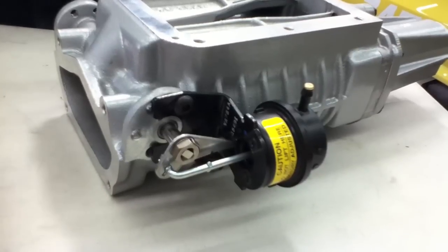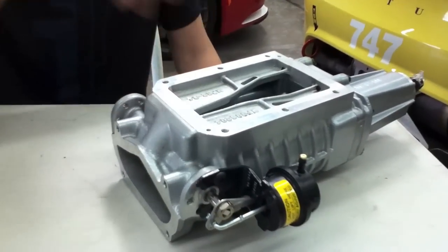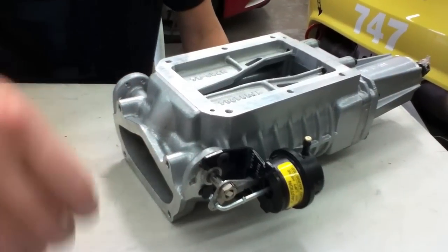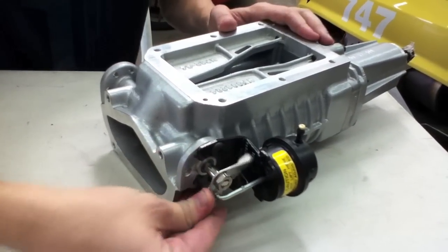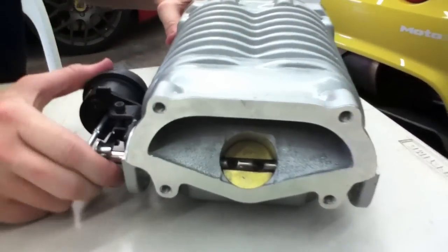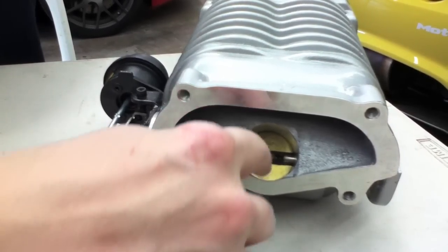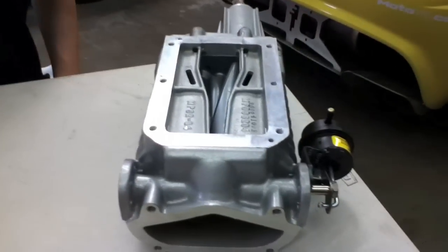The final piece specific to the supercharger that we'll talk about today is the bypass assembly. Because the engine doesn't always run at wide open throttle, you need to provide a mechanism for air to escape around the roots blower and enter into the engine without making boost — this is so you can drive around on the highway at normal drivability. The way this system works is this little can here has a diaphragm inside it that actuates this lever. If I push down on the lever you'll see it move, and if you look down inside of the supercharger itself you'll see a little valve in there. As that lever moves, it opens that valve, which leads into a passage where air comes in to the supercharger, goes through that passage, and exits out into the engine — effectively bypassing the rotor blades.